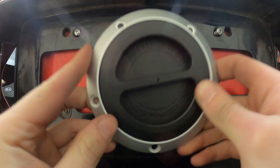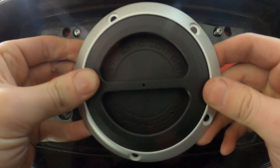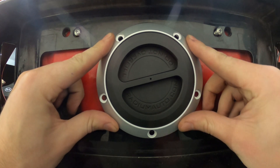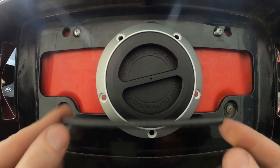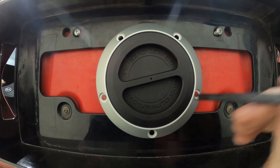The hole is drilled and the cap fits in really nice. The next thing is to clock the mounting plate so it doesn't interfere with those holes. I'll use a transfer punch to get my hole positions accurate. If you don't know what a transfer punch is, they come in sets and are super cheap on Amazon — you match the outer diameter to your hole and it helps maintain concentricity and alignment.